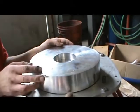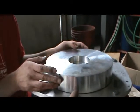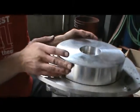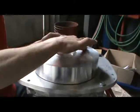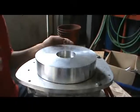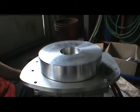Yeah. So I gave you 80 back. If you don't feel comfortable with it, I can take another 20, but I'm looking at 60, 70 thousandths there, I think. As long as it can rotate like this and it doesn't touch the adapter plate. It's not touching anything, and you're not rubbing inside either. You don't hear any rubbing, so obviously it's cut out enough.